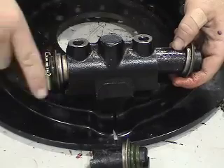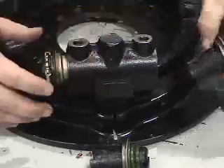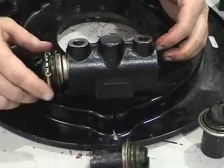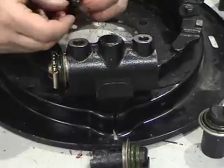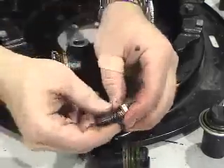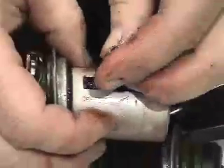Looking at wheel rotation, we would figure out which one had the most force on it from the self-wedging or self-energizing action. In this case it's only a single actuator, so we'll put both adjusters on one side. You see the small cutouts on the pawl that have to go into the pawl guide, which is this portion here. So it's going to lock into our adjuster like so.